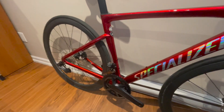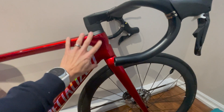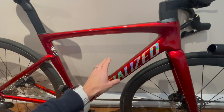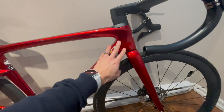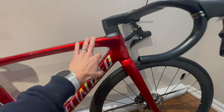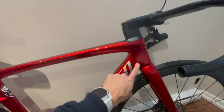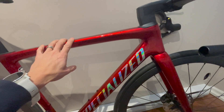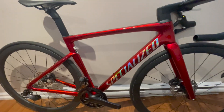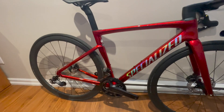In summary, it's no drama. I didn't expect difficulties because of it being a fake frame — I knew it would be tough — but the challenges aren't related to it being fake; they're related to the fundamental design of this frame. In hindsight, if I had to buy the genuine frame, I'm not sure I'd buy a Tarmac if you plan to do any maintenance or assembly yourself — it's painful. There are lots of proprietary parts; the seat post isn't even round. Maybe I'd be more tempted by the Aethos because it's more standard. But I have to admit, this one looks great so far. No big flaws found during assembly.